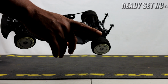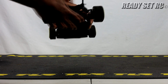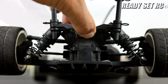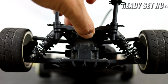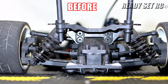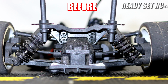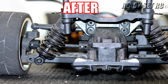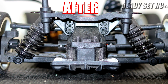But I'm gonna show you something. That's the rear. That's what you're getting. So the rear is bowing so much that's why the car goes so low. But that's another issue that's going on with it, that the ground clearance in the rear is just downright horrible, which is why the back of the body rubs on the ground. And I adjusted the body post in the rear to kind of alleviate that, and it did a little bit, but it still does scrape quite a bit.